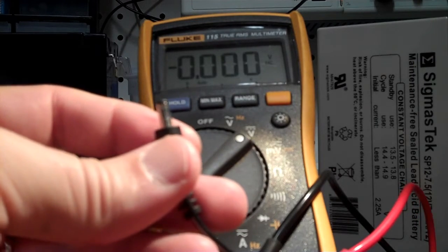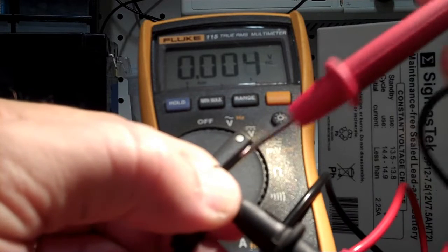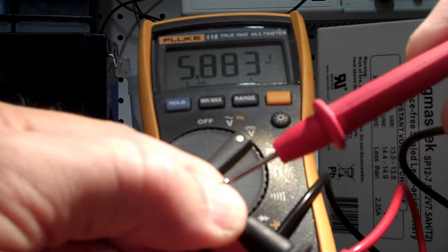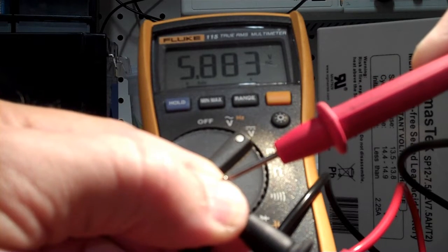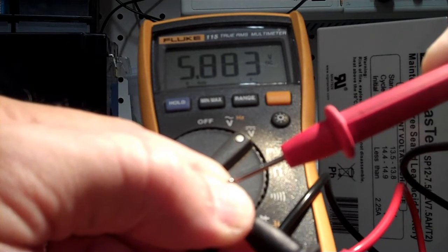First things first, always verify the power supply is actually providing power before you try to fix a device. Alright, 6 volts. It's actually rated at like 2.5 volts, but it's probably just a transformer power supply and it doesn't drop down to 2.5 volts until it's under load. And of course, when dealing with beard trimmers or shavers, you'll need a vacuum.